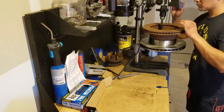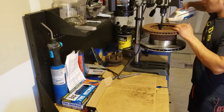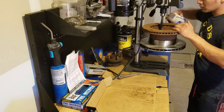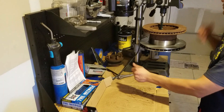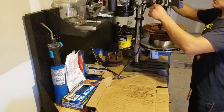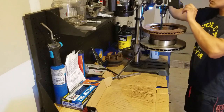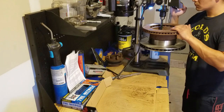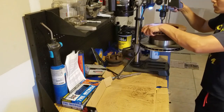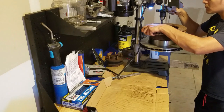I'm using a 5/8 drill bit and some gear oil as a lubricant. Other people use transmission fluid or cutting fluid — you can use pretty much whatever you want. The trick is to go at a slow speed and give it time so that heat doesn't build up as much. Here I'm finishing centering the rotor onto that mark I made on the Grand Cherokee rotor, and we're going to be taking it slow.